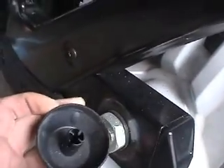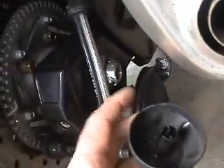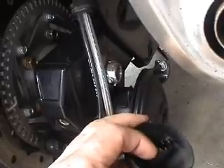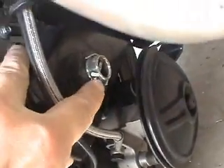Remove the caps from the rear axle nuts on both sides. You'll notice that particularly the right-hand side cap has a split in it — that's so that the cap can go over the split pin and into the center of the axle.